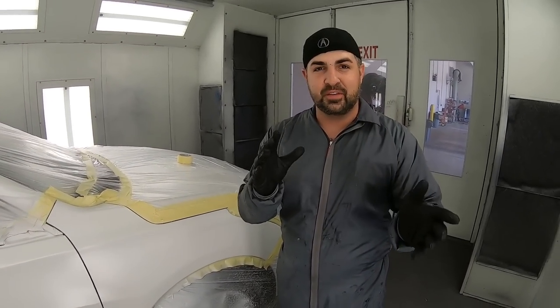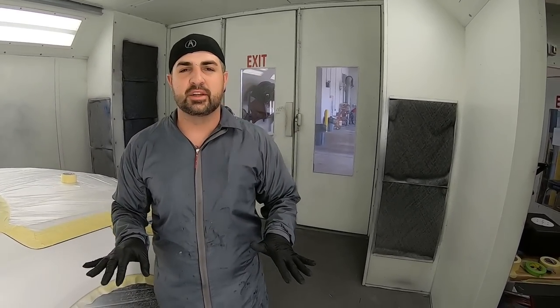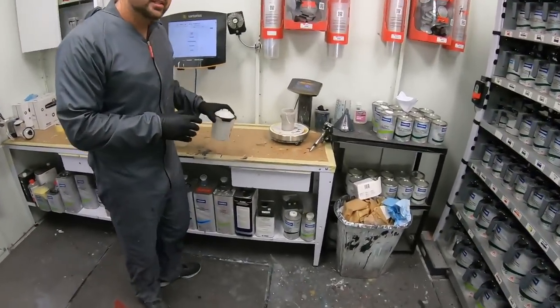is I'm gonna mix 50-50, one-to-one, half and half, the pearl and our base coat. And I'm gonna do one coat, and you're gonna lose that transition, and then I'm gonna do 1.5 coats of pearl, and you won't be able to see the difference. Come over here. Mario, you might wanna learn from this, okay?